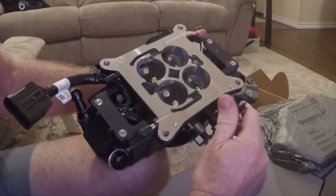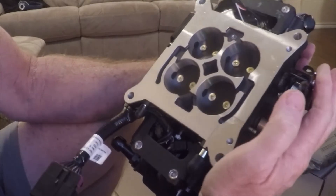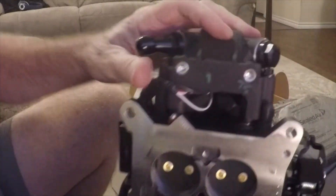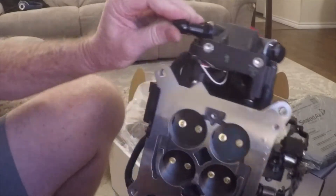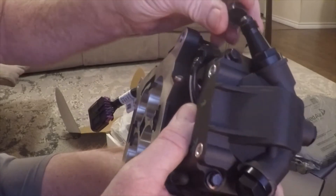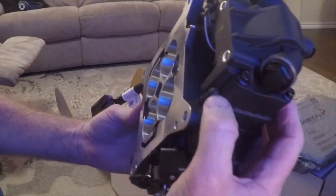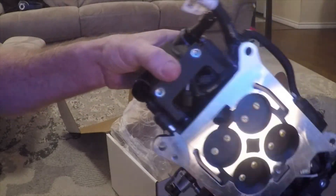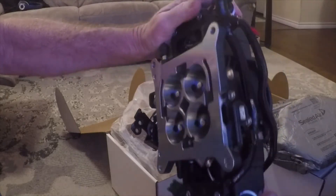I don't see those here. You can see the injectors in there — they'll probably just run straight in. That's probably about a 6AN fitting. I have to see if it hooks up to my fuel rail. It's got a vacuum port at the back, then a bigger one. It's got two at the back — a small one and a bigger one — then one at the front.